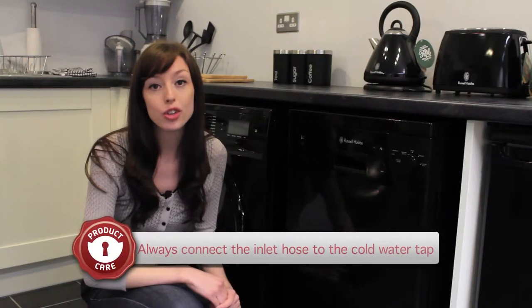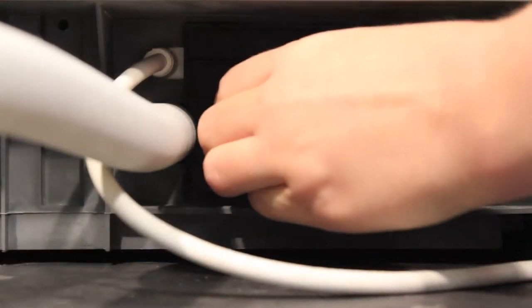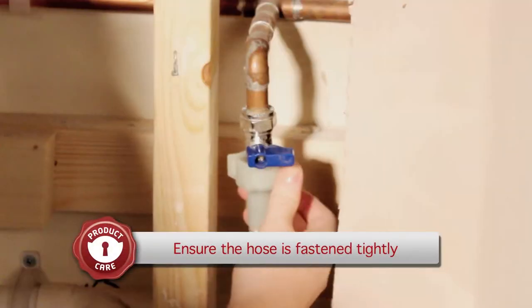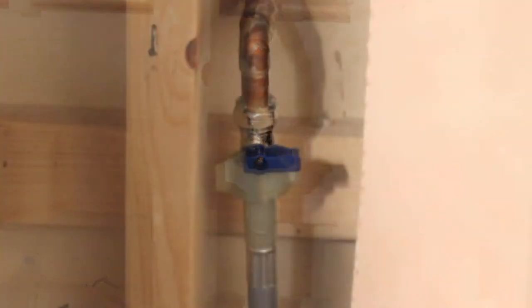To install your machine, you will need to connect the water inlet hose provided to the back of your machine and your cold water tap. It's really important that you use your cold water tap as the machine will heat the water when in use. Also ensure that you use the water inlet hose provided and not a previous one. Turn clockwise until it is attached tightly to each end. When it's connected to both machine and water tap, turn your tap valve to the open position.